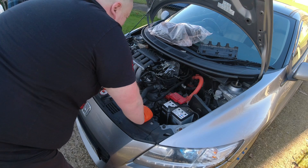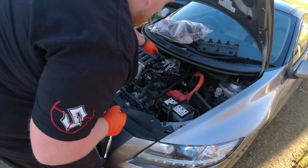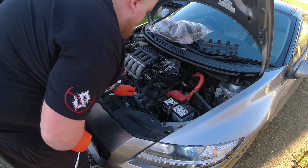That's the airbox out of the way now. I've removed the bracket that sits here as well — it's connected in here. You will need to remove that, because otherwise it's going to damage the new intake manifold. There is no fitting for it; it would normally bolt there. Next up, I am going to remove the throttle body. You don't need to disconnect any hoses, you only need to sort of drop it down out of the way. Once that's out of the way, there are a couple of bolts behind it — these four bolts here that you need to remove to get the throttle body out — they are a 12mm.